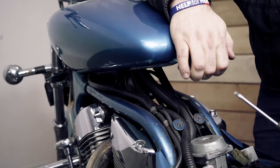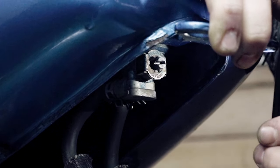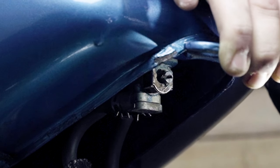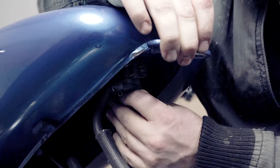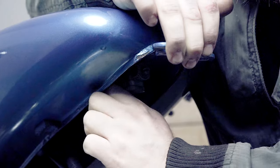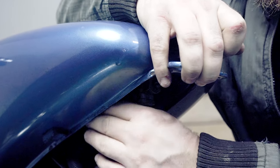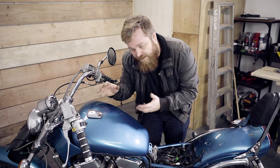Under here you'll be able to see the petcock. You see how it's at a flat horizontal 90 degrees? That means the fuel is off, so it's safe to remove these two fuel lines. If it's in an upright vertical position, the petcock will allow fuel to flow — so make sure it's definitely off before you go removing these pipes, otherwise you'll have fuel all over the place. There are some clips here that you might be able to wiggle free with your hand; if not, get yourself some long nose pliers. Now we should be able to remove the pipes. There's pipe one and pipe two — they're just push fit. Now that the petcock is closed and the pipes have been removed, we can take the tank straight off the bike.